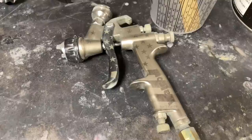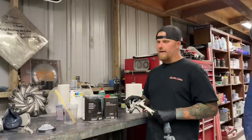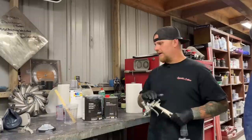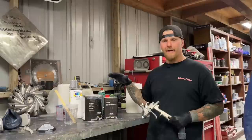I actually really like this Walcom. These are made in Italy, they're very affordable — only a couple hundred bucks — and it sprays incredibly nice. The 1.8 tip will do everything you guys need it to do: fill pinholes, take care of your metal spots, seal up fiberglass. It is an amazing primer. And the best part is it doesn't shrink down like all the others. They all have a level of shrinkage, but this particular primer is done shrinking in three days.